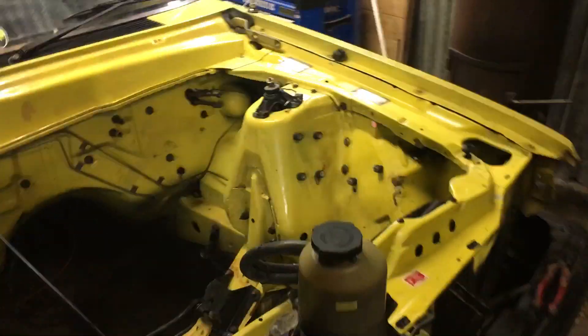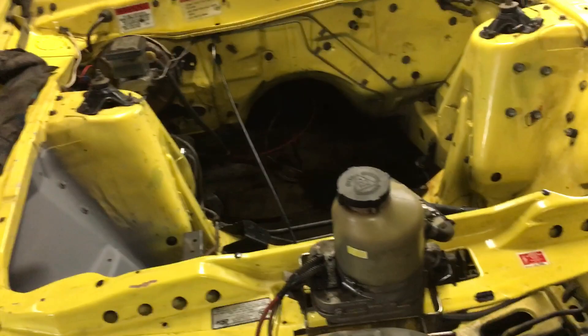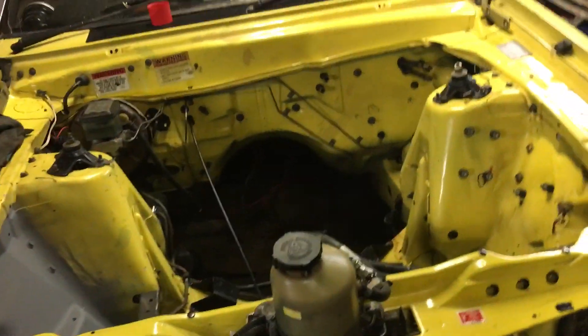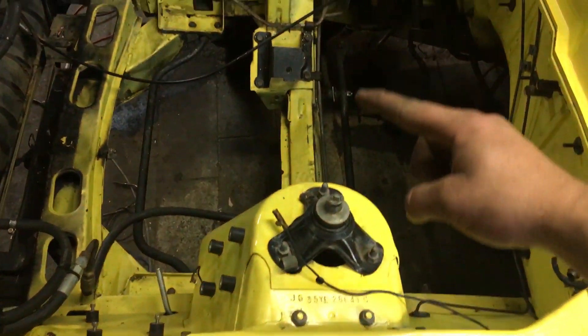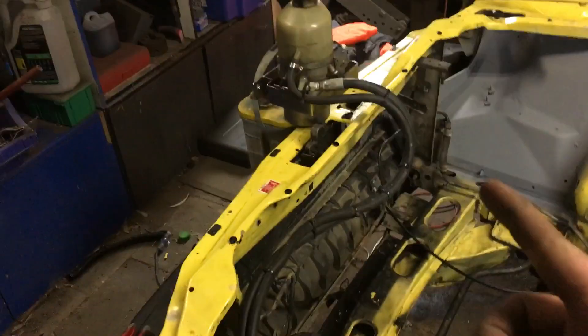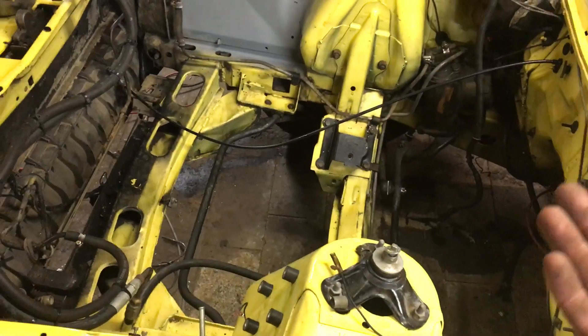You will read on the net that there's a bit of a delay with the power steering, but I've had this car on the road for about a year running that pump and the only delay is when you first fire it up — if you don't wait for the pump to charge the lines it's a bit stiff, but other than that it's good. I left the Ford factory power steering rack in and just ran it off this pump, using Ford-recommended oil because I figured if the oil does damage something it's easier to sort out.